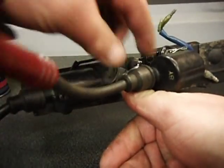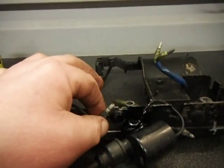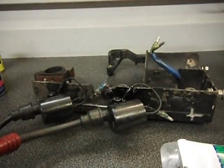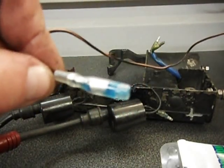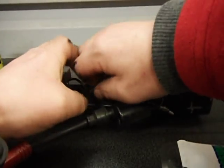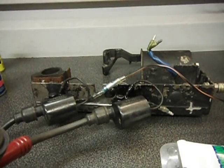Obviously when you go to make a connection, these little bullet terminals that you get on them as well — a good idea is to just slide the little rubber boot off, poke a load of the corrosion block electrical grease in there, pop a bit in there as well, and a load on this bit. When you do come to make your bullet connection — this is the one from the engine side — pack a load of the terminal grease in there as well, just so it gives you a nice watertight, well lubricated electrical terminal. If you do this before using your engine, even if it's brand new, do this — it will make a difference.